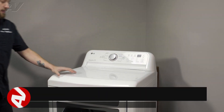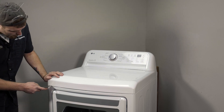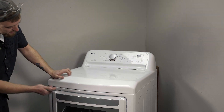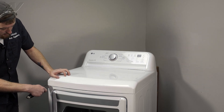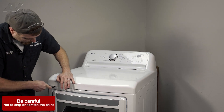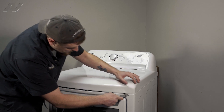To begin, let's first lift this top panel. You'll need a putty knife. On the corners, they have a small triangular locking tab that you have to press in with the putty knife and lift up. There's not a lot of room to see exactly where it's at, so use just the corner of the blade. Go about an inch in, press in, and start to lift up — you should feel it bending. Once you get one side up, it's easier to see the second side.